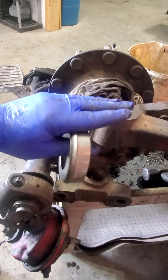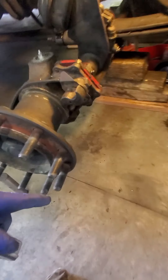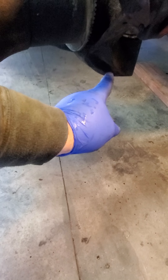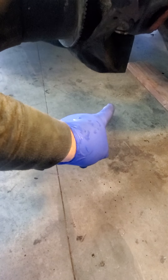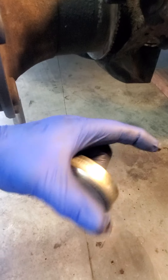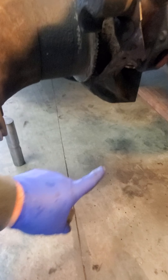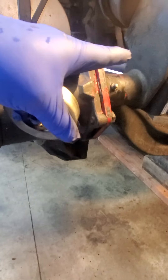So I had a problem. My bottle jack was down here. I started the kingpin first into the housing, and then I put my bottle jack underneath there. As I was raising or lifting the truck with the pump, it was lifting the truck. I had lubed the bushings and everything - those two little copper pieces I was talking about. I lubed the inside of those very well, I thought anyways.